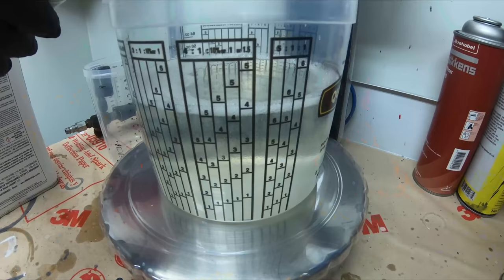And you cannot forget to put the hardener in. Who here has been down the route where you forget to put the hardener in the paint? One? Yeah. Yeah, it's a mess. There's no way around it. You can't put hardener over it. There's no way. You gotta take a whole bunch of lacquer thinner rags and wipe it off.